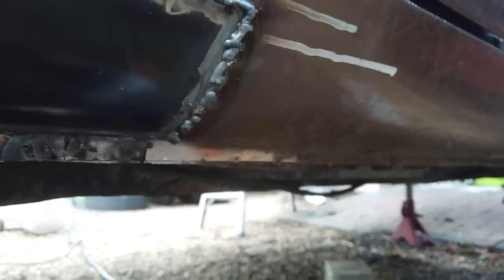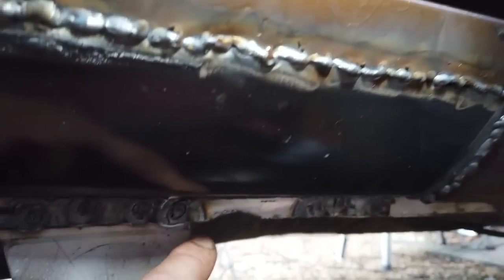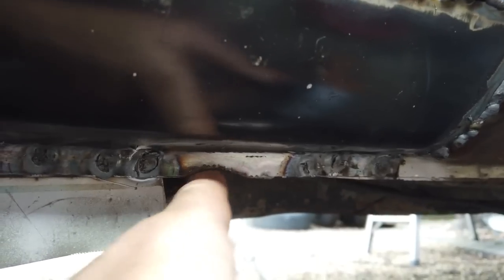It's quite a flush surface. A little bit where it sticks out here, we just knocked that in. I told you about the profile mismatching on these. We'll get it in the body shop with a filler. Can skim off this plate now. That's spot welded on. There's the shape for the jack. That goes straight in. So that's good. Jacking point was good, as you know.